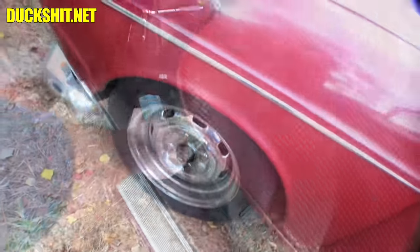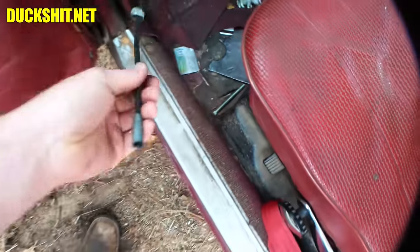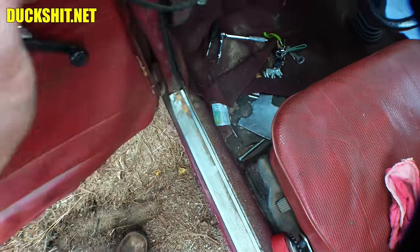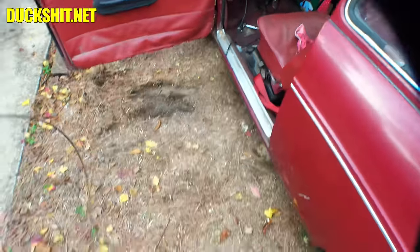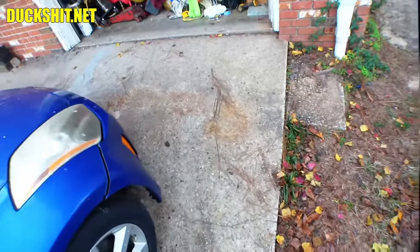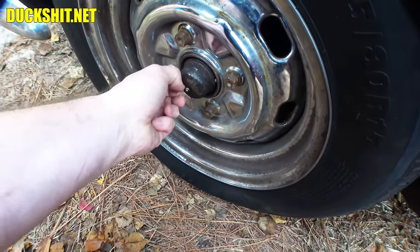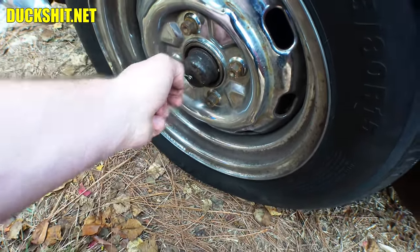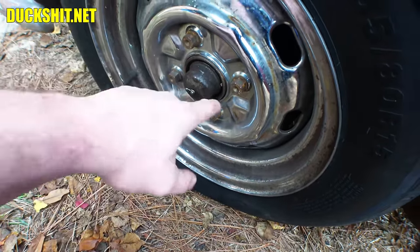I came back up to the top side here for a second, and I pinched the cable coming out of here. In my mind I pictured this end broken off in the back of the speedometer, but yeah, it's broken — it wouldn't come out if it weren't broken. So it's definitely broken. The little nub is broken down here. This is not at all what I expected. I think I'm going to have to pull the bearing cup off because I don't think it's going to pull through — not a big deal, get in there with a little pry bar and just pop it out.